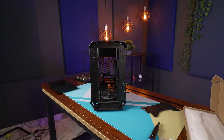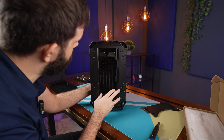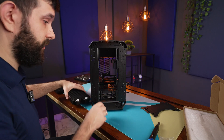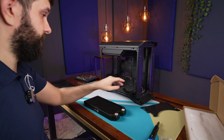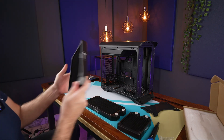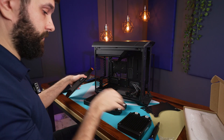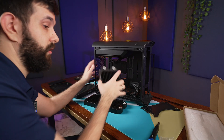Let me do a quick check — I'll take a radiator and see if it fits in here. It just about fits. So next stage is to mount some fans to these radiators and just do a quick test fit — we'll hold it in place and see if things are actually going to fit in the right places. We're using a BitsPower kit with a whole stack of different devices. We've got two large radiators — the idea is to have them on each side. And I'm also planning to install a smaller radiator at the back. It's going to be a tight fit, but if it all works out, this is going to look like a really cool loop.